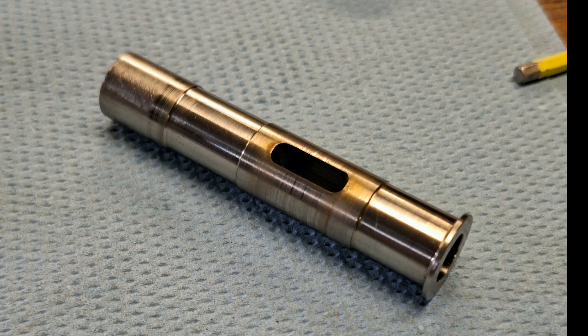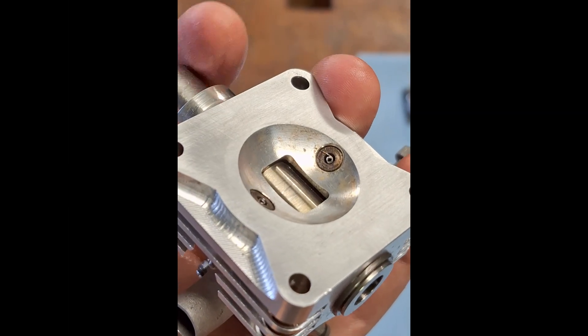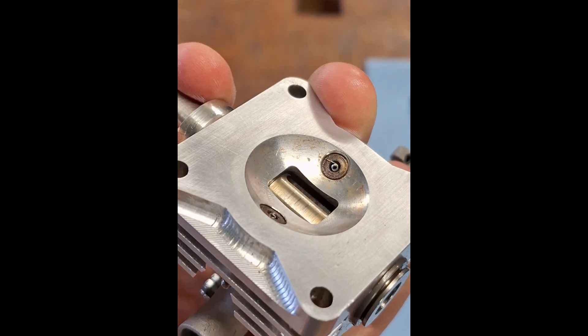Now let's take a look at the centerpiece — the rotary valve. You can clearly see the bearing point on the timing belt side. There are slight signs of wear in the bearing area around the timing opening, and slight burn marks around the opening. However, no lateral breakthroughs can be seen from the sealing surface — this meets my expectations and can be rated as good. On the rotary valve liner in the cylinder head, the friction surface looks normal for a plain bearing. On the center web, you can see marks or nicks in the radial direction. There must have been material detachment or foreign particles between the liner and the rotary valve when the engine was running — that's not good, but no cause for concern yet.